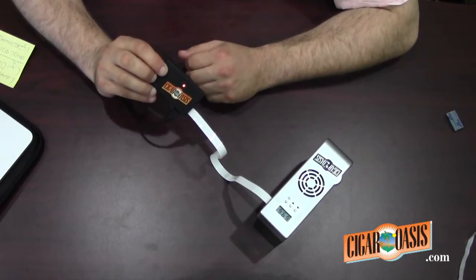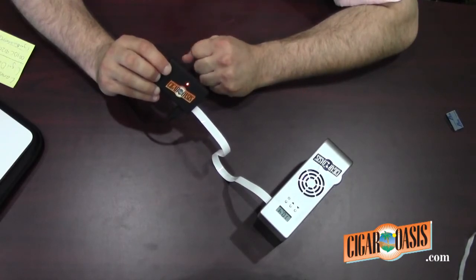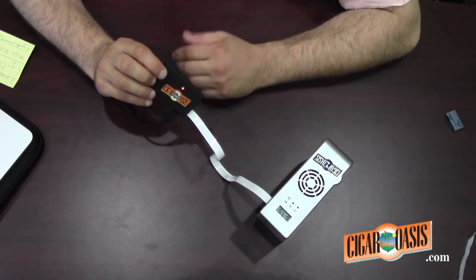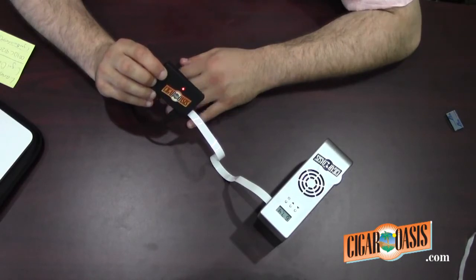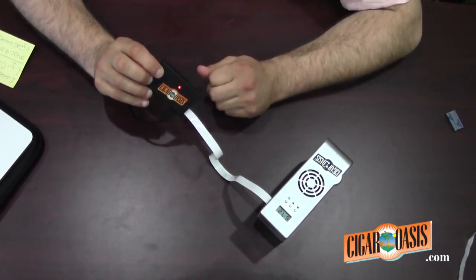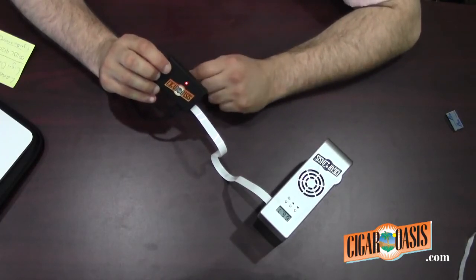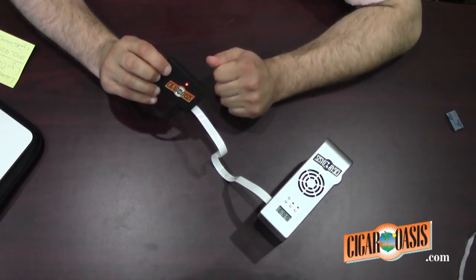Okay, if you do not get a success symbol, that means a message on the website, for whatever reason it didn't work, you want to repeat steps 2 through 8 again. That means you want to add the device again. For whatever reason, the Wi-Fi network wasn't picking it up, but it should work. And don't press the sun button multiple times. If it's not working, just start the add the device. Maybe it's possibly you have the wrong MAC ID. You put in 1 digit incorrectly, so do that again, confirm it's correct, and then configure it once more.